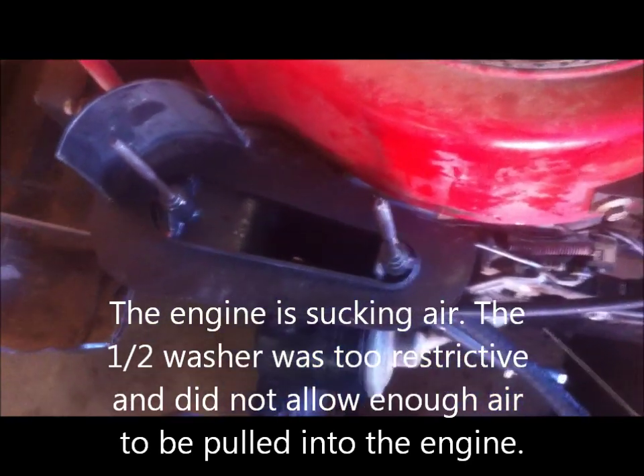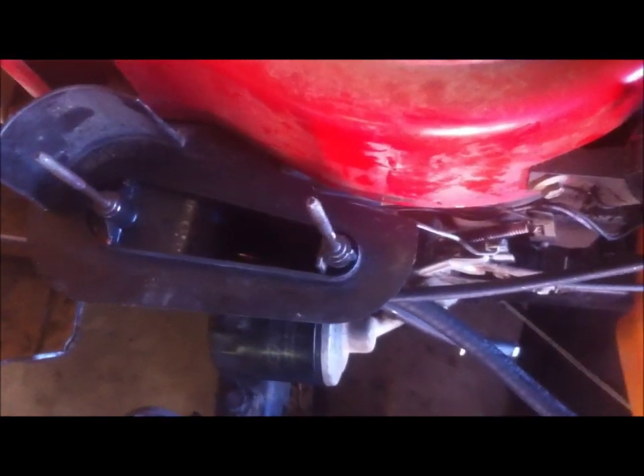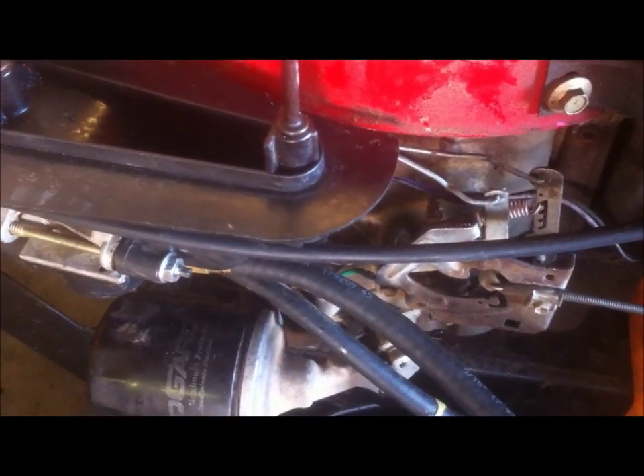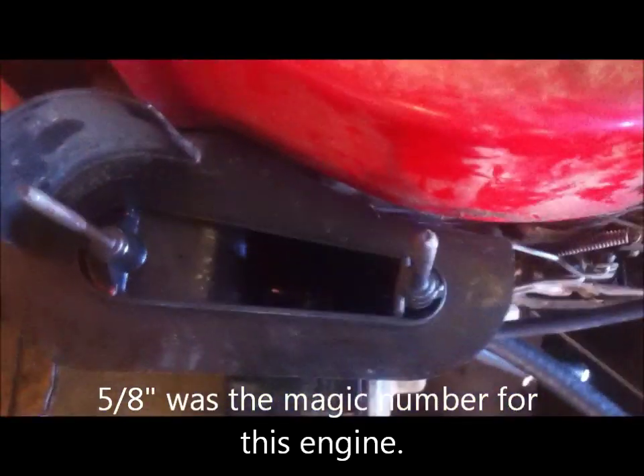Currently that's the max throttle I can give it — you can hear it really sucking air. I'm going to throttle it down. It runs a little better when I throttle it down. I'm going to shut it off. I'm going to take this air box off and drill that washer spacer out to maybe 9/16ths inch or so, and put it back on and see what happens. The purpose of the washer is to increase the velocity of the air going through there, which will create a vacuum in that tube that's sucking the propane out of the regulator. Without that, the other option would be to completely drill out the carburetor.